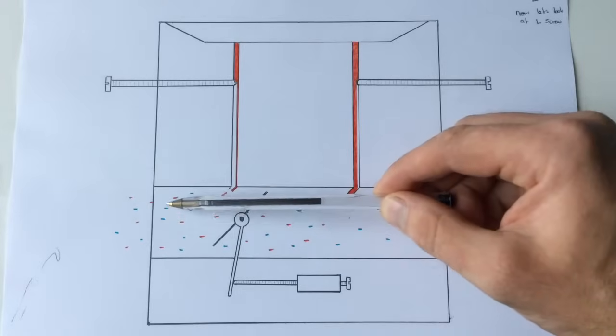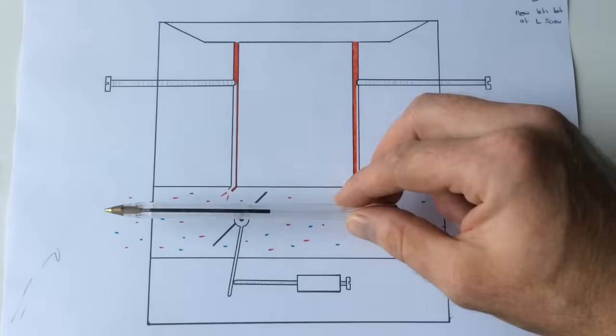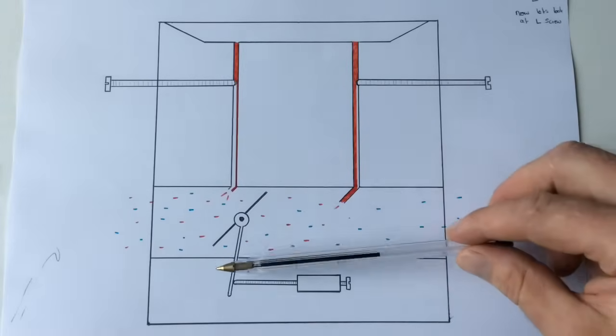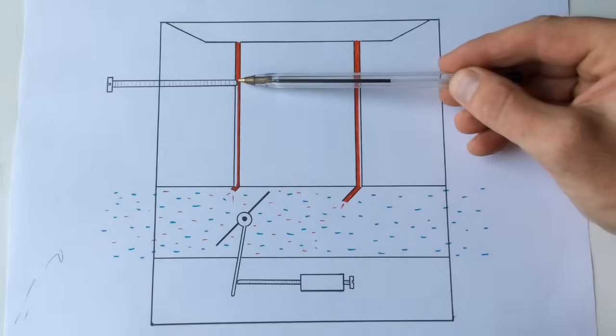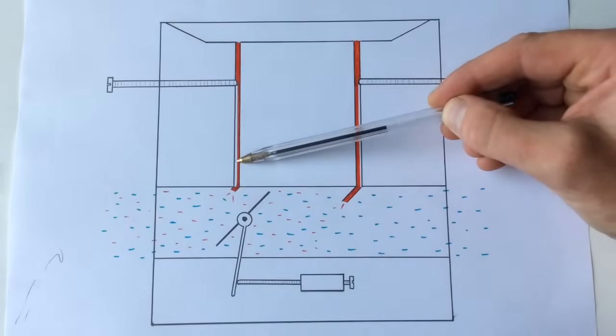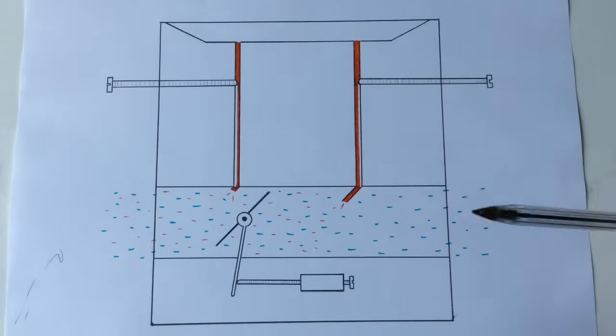So this is out one turn and at the moment, looking at this diagram, we can see it's not a bad mix of air and fuel. So the engine might work quite well, the engine might tick over quite well. We've got to get it just right - so if we look here, we've opened that slightly and there's more fuel coming through.